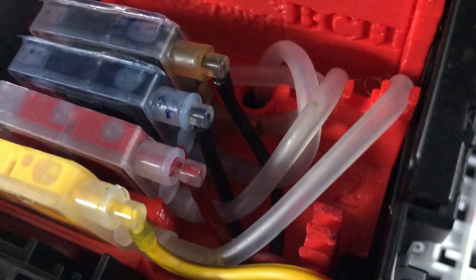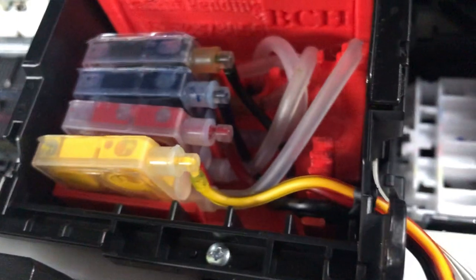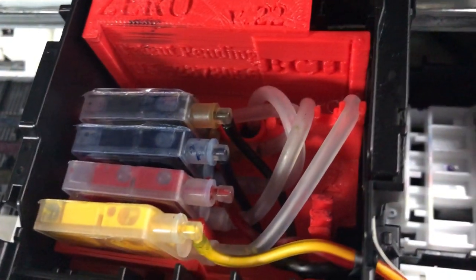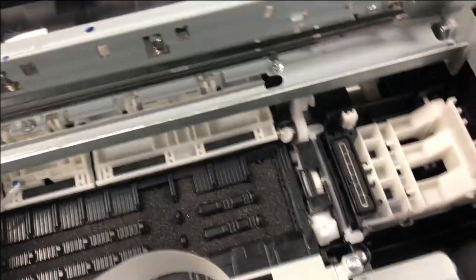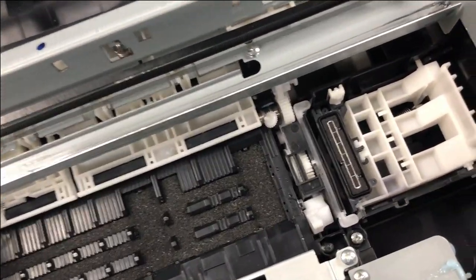You can see the large tube is full of air. This is especially true after shipping, where the printer dumps out the ink during shipment. So our next goal is to fill those empty tubes with ink. We're going to use Epson's built-in functions to clean the print head.